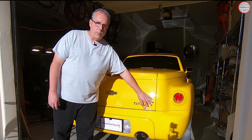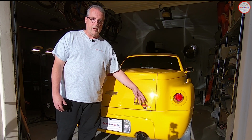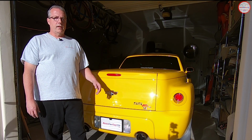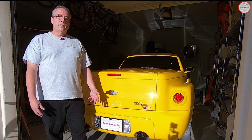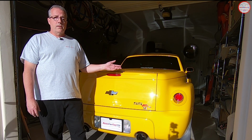And you'll see where the arms are for the tailgate, the water would actually go into there and drain into that. And I'd have a puddle of water sitting there sometimes, or just underneath the carpet kit on my 2005 Chevrolet SSR that had the carpet kit. You could actually see water. If you lifted the carpet kit, there's water underneath it, and I could smell it when I would open the cargo area. So with that, we'll identify the corrective actions that I made in each of those areas.